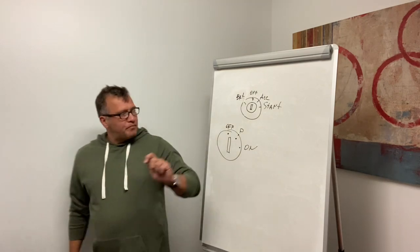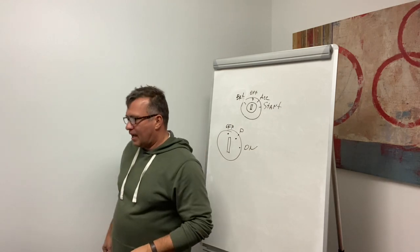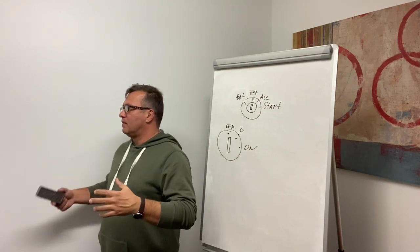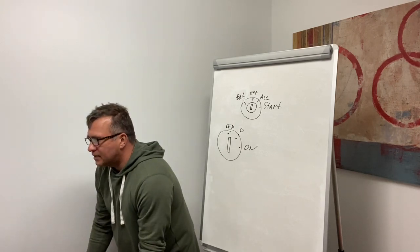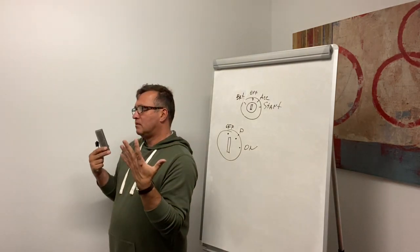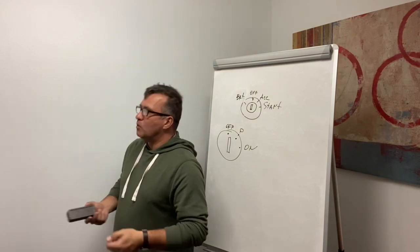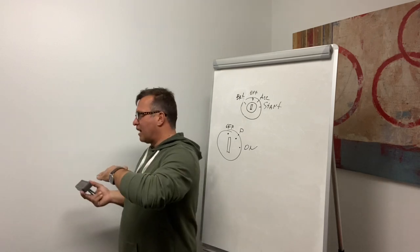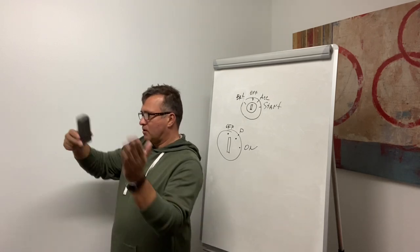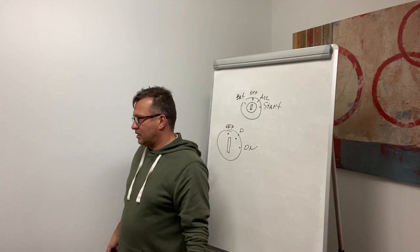You put it in accessory and wait. At this point, it will perform self-diagnostics. All dashboard lights will come on. Most of them will go off, some of them will stay. You wait. Your gauges, the arrows, will perform self-diagnostics as well. Sometimes it's 5-10 seconds. You need to wait this time.